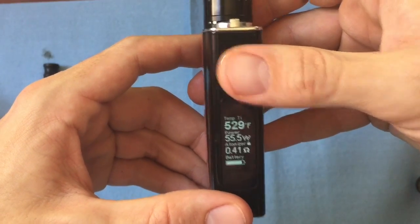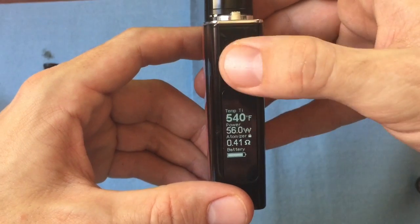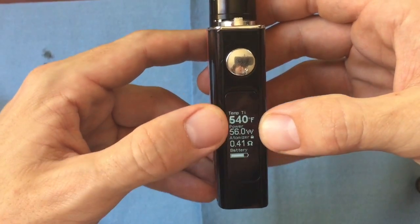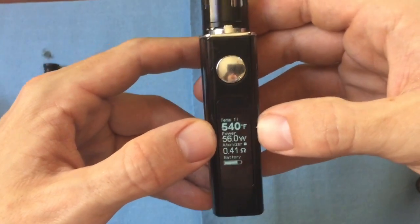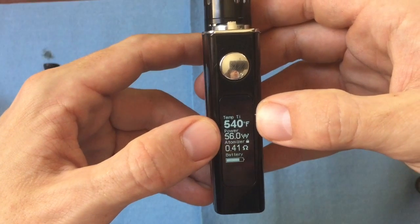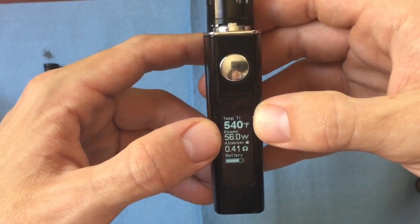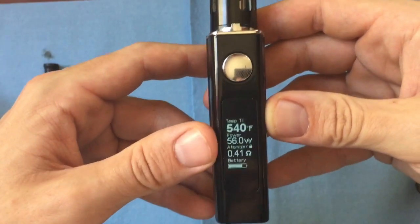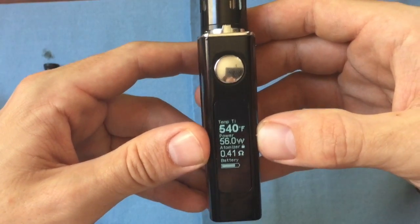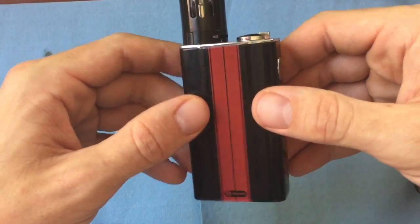So now that it's locked in, power watts. Now, as you saw the difference before, look at the wattage going when I'm vaping. It'll surge up to 52, 30, 41, and the reason is because there's juice in there. It actually knows how dry or wet your coil is, and once the juice begins to get depleted, as the coil was previously, it'll ramp the power all the way down to 5, 6, 7 watts, and it'll go into protection mode so it doesn't burn the coil. What does this mean? Your coils are going to last a hell of a lot longer, and it also means that you're going to get more vape out of the actual battery because it's going to use every last drop of juice that's in there.